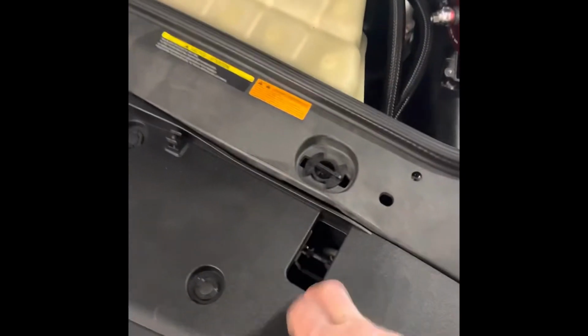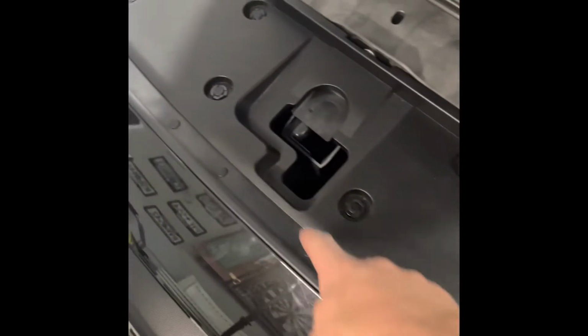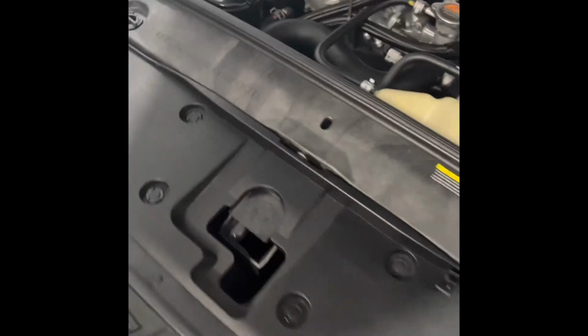So you have to take off the shroud, take off all these little clips right here. And then underneath that, there's some more clips for the top part of the bumper, all down through here. You gotta take that off. Then you gotta jack the car up in the front, put it on stands, because you have to take this whole inner fender out. And it is a pain in the butt. So you gotta take out all these screws right there, right there. I think there's a bunch of little clips, and they're all the way around. So you have to take all those out.